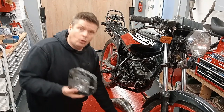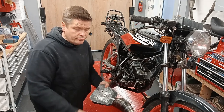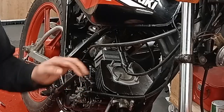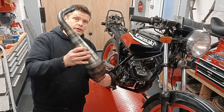So today what we're doing: I've cut a couple of new heads, and I'm going through how I've cut these. I've increased the compression, but I've got two different squish area ratios to try. I've also put a nice little O-ring in there for better sealing, and a spigot in the top of the barrel for location. And at the end, I'm going to try a short pipe just to see what happens.